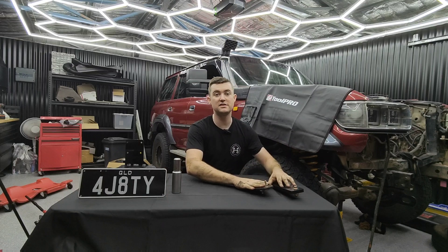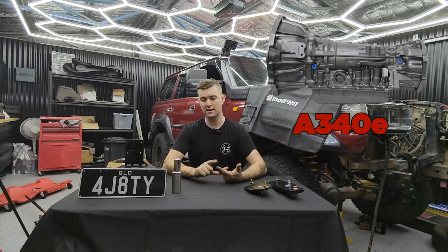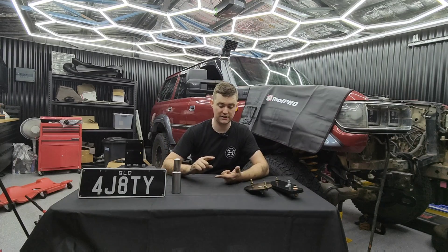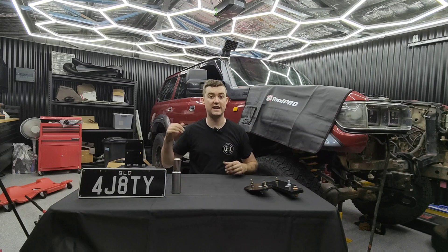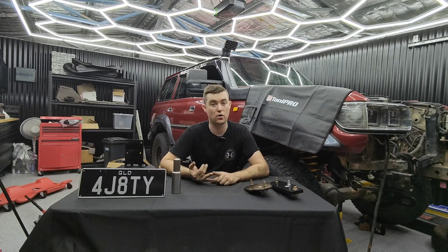The next step is to figure out exactly what transmission you're going to be using with the 4J. This kit is designed to use the standard automatic Isuzu gearbox - that's the A340E transmission out of a D-Max or a RC Colorado with the 4J. I've got one just down here in front of me that I got from a wreckers. It's been built by G&L with an upgraded valve body and upgraded torque converter. They're both upgraded in this box, ready to go with a full wiring harness and everything. It does use the A340 out of the D-Max or the Colorado.